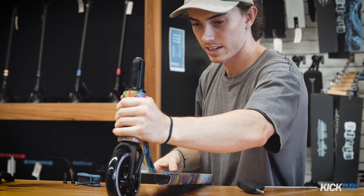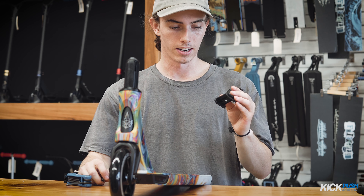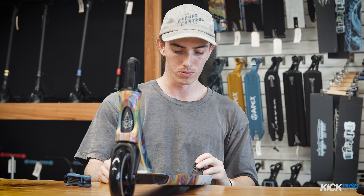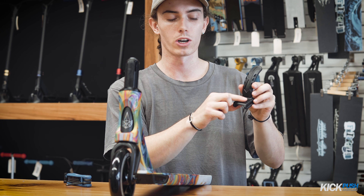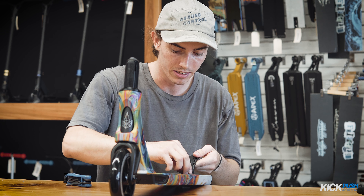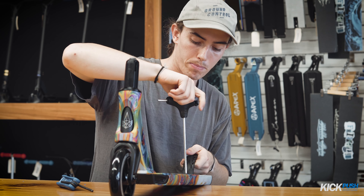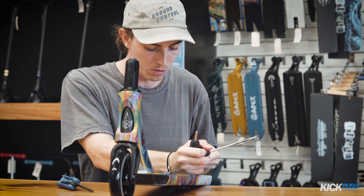Now we can move on to the back of the deck. First one is the brake — a very common and overlooked component, especially with an undialed scooter. A lot of the time it is the brake which is undialed. Brakes come in a lot of different shapes and sizes. The Envy Nylon brake is really good just the way it's shaped — it fits really nicely and tightly. You will get some more metal brakes that have a simple rubber cap on top, which sits between the deck and the brake itself. That rubber cap is really important — tightening that will reduce vibration and you won't have metal on metal, so you won't even hear a rattle. Tighten the brake pretty tight, obviously not to the point of stripping it. The brake is definitely not moving around, which is a good sign.